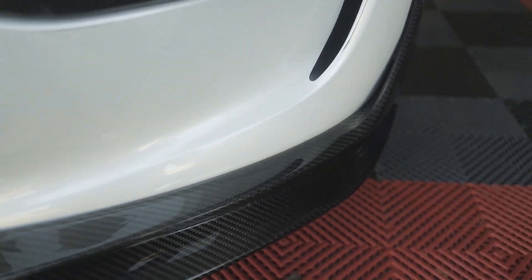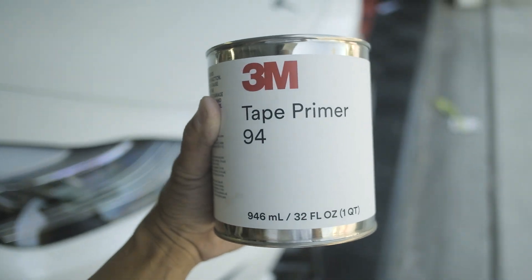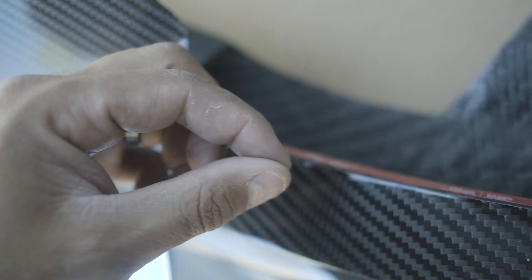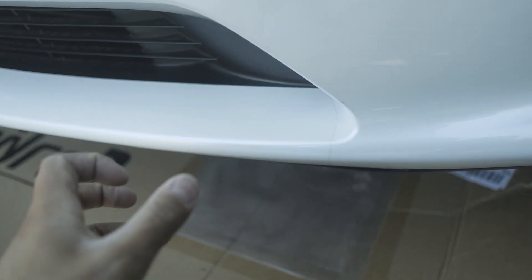I had already cleaned the car so I'm going to give it another quick wipe. I'm using 3M tape primer — adhesive promoter — to make sure the bonding surface is well prepped so it's never going to come off. On the back side along the edges there is already 3M double-sided tape applied, also on the bottom. I'll use my knife to peel back just the edge and fold it over, so when I put it on the bumper the release film is just slightly exposed at the tip, keeping everything aligned before full adhesion.